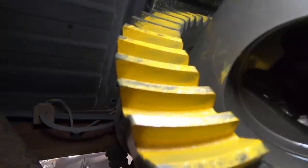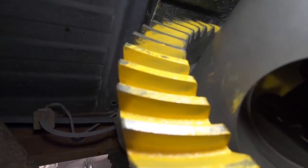So I've had this gear set in and out of the axle about a dozen different times. And then it made me think back to when I did this the first time in the other 8.6/10 bolt. I had kind of the same problem, where I tried many, many different thicknesses of pinion depth shim just to chase the pattern down and get it exactly where I wanted it to be.